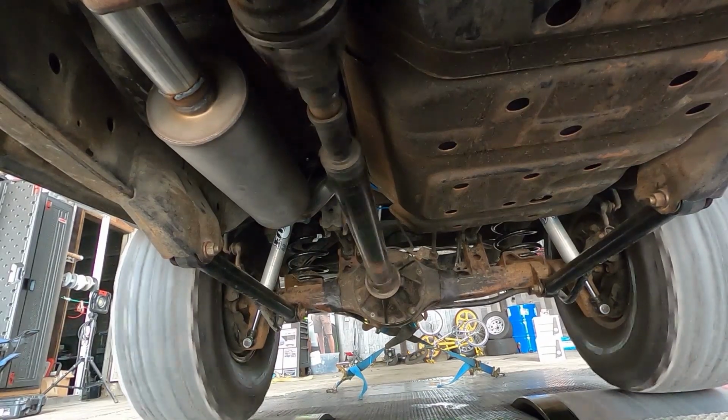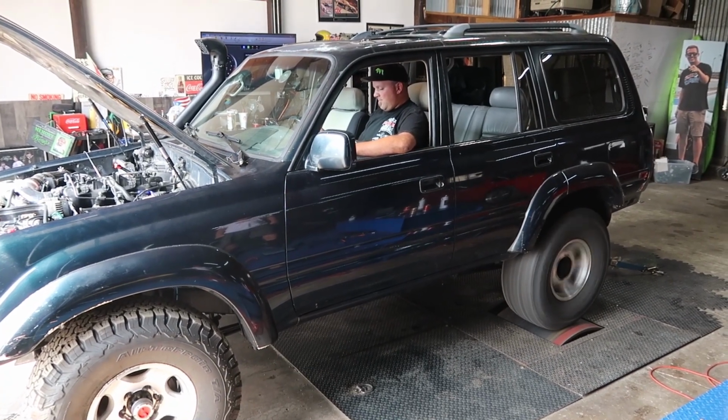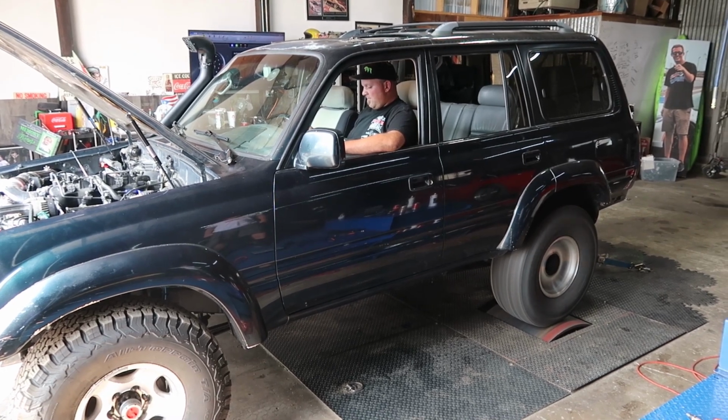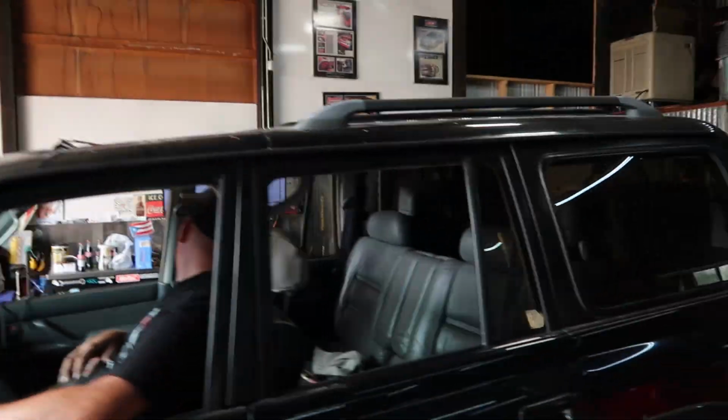All right, so we're gonna go one more time here. Command first gear. Wait for the wideband to finish heating up here. Second gear. That sounded good. That sounded really good. I moved that thing so it's hard for everybody to see. 162 with 201, boss. And it looks better throughout the whole range. That was just pulling some timing. It's looking good.